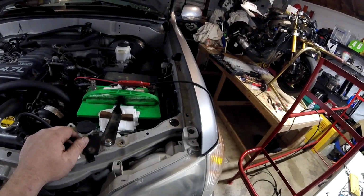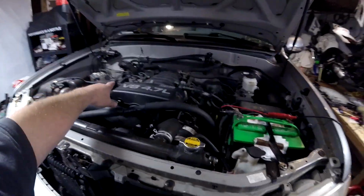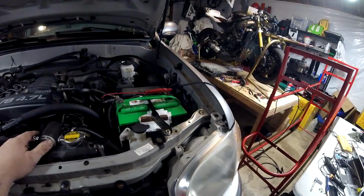But if that thing gets below 12 volts, which is not good for them, when I fire the Toyota up and it's already got a high starting battery, most of that voltage will go straight to the back. It'll go straight back there and try to recover those batteries. And it'll throw some amps. And I think it'll throw more than 40. And I think it'll pop those fuses. It's a 90 amp unit, so the alternator puts out over 100. So the alternator puts out more than that isolator can handle.